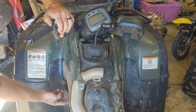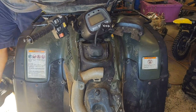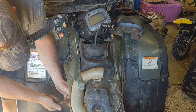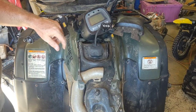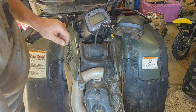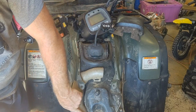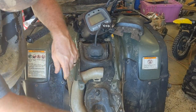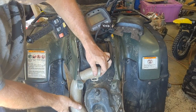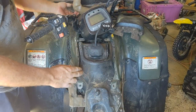To get the gas tank off, you also need to take the petcock handle off - it's a Phillips headed screw. Sometimes these can be tough to get out with mud caked up in them, so just clean it out. You also need to pull off the snorkel. It doesn't have a clamp on the air box on this ATV, though it's supposed to. Pull the push pin out that holds it to the frame, then wiggle the snorkel out.